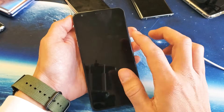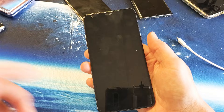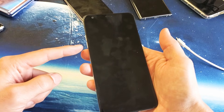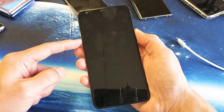So the first thing is this. This phone is fixed, but let's just pretend it has a black screen. I want you to force restart it — and you're not going to lose any information. You're going to press and hold two buttons: the volume down button and the power button. Press and hold both buttons. Do not let go until we see the LG logo appear.